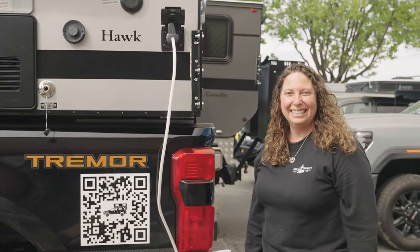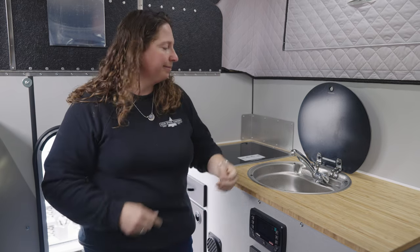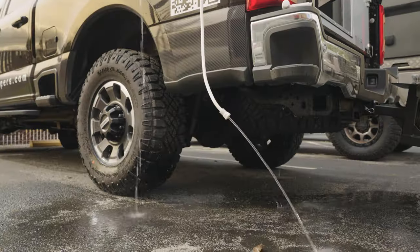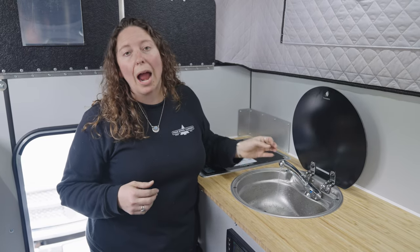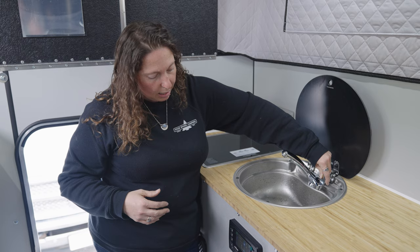Then we're going to go inside and open up the faucets to allow water to drain from there as well. It's really important to stay near your camper while the water is draining because once the water drains, you do not want your water pump to run dry. As the water tank is approaching empty, it's going to start to sputter. Having your camper on an incline will also help drain more water out of the rear drain. Now the tank is mostly empty — there's a little residual, so feather the pump in hot and cold position to get as much water out as possible, since that's what's going to freeze your pipes and water manifold.